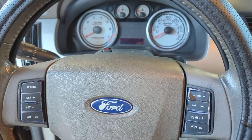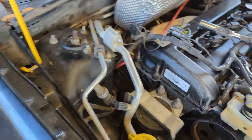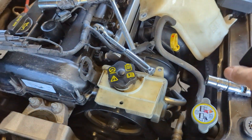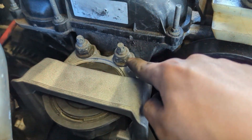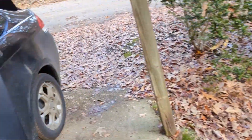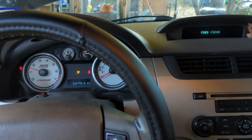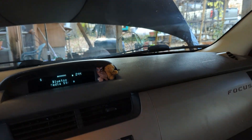I really hope this is a little bit smoother. So now we're in the car — I've got everything buttoned up and looking good. I really wish I had gotten a clip of the sound the engine was making before this engine mount got replaced, but by the time I thought about it I'd already had everything disassembled. Just a quick note: make sure the studs go down far into the engine, and get the bolts nice and hand-tight until you feel them stop rotating. With that, let's go ahead and start the car. Wow — that's just incredible. It's like a different car. I don't hear all this vibration. Wow.